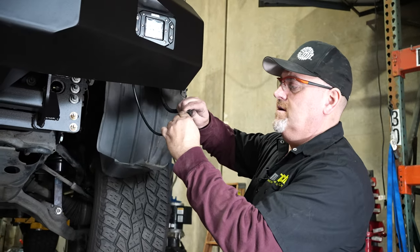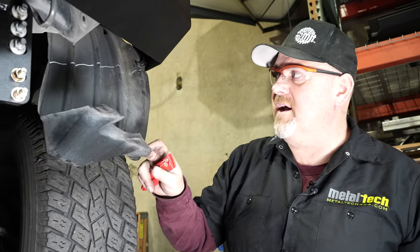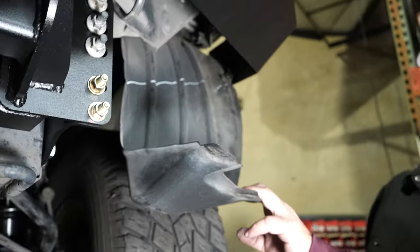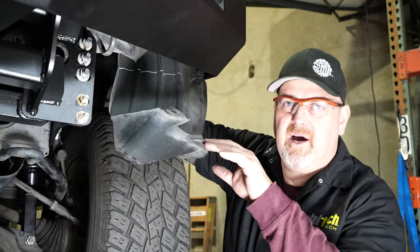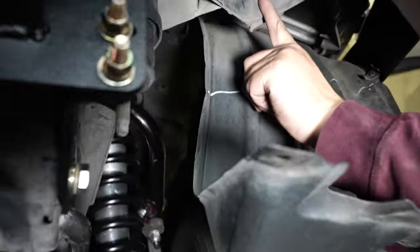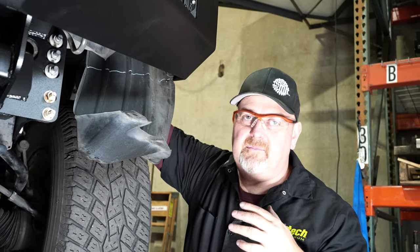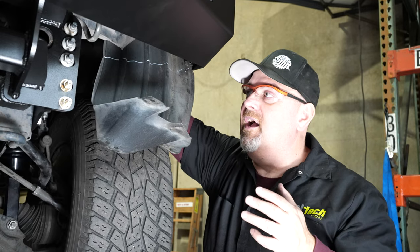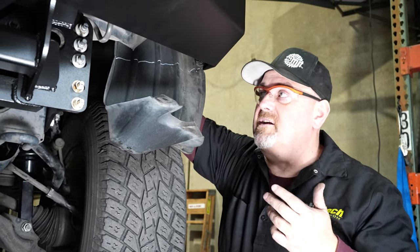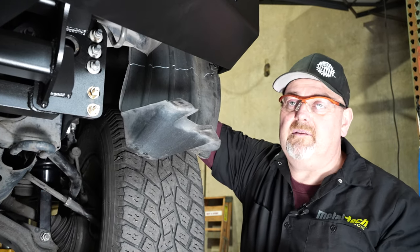We're going to plug our fog lights in and use some zip ties to tuck the wiring up behind inside the truck. The wheel well liner is just a plastic liner and we're going to cut it. It doesn't need to be super precise since it's hidden behind the bumper. Once we cut it, we're going to use a zip tie and anchor it up against the body — there's a nice little hole in the body in the upper area to put a zip tie through. Wind pressure going down the road will hit this, and if it comes loose it'll flip back into the tire and sound like you ran over something massive. Zip ties work well once anchored correctly — just put the zip tie in and this side will be done.